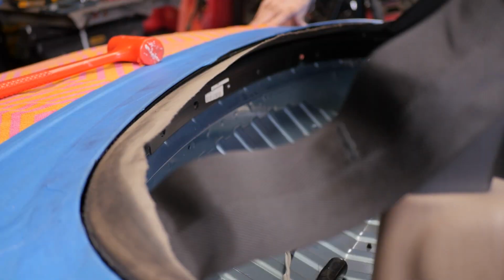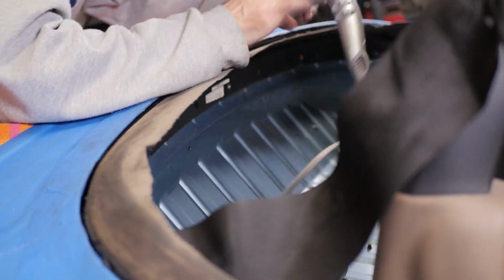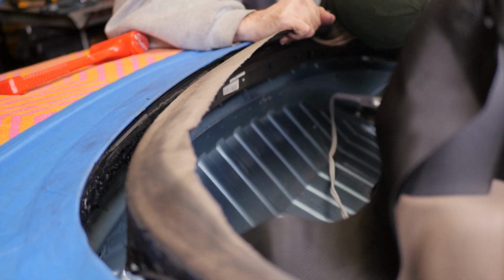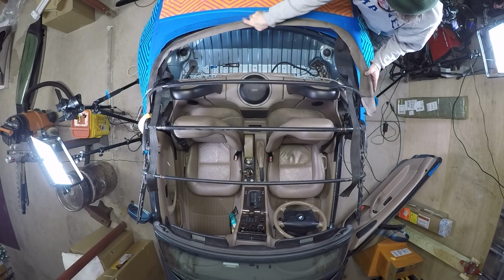This took a very long time to get the butyl rubber to release, but work at it slowly and it will finally start to give. As one section comes free, move on to the next, then back to reheat. You want to get the whole unit to a point where all the butyl rubber is pliable. Then you can finally lift the bow out and free.